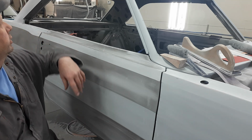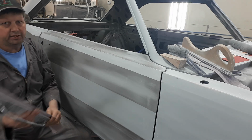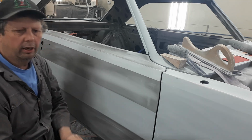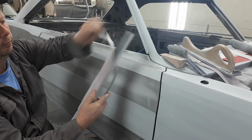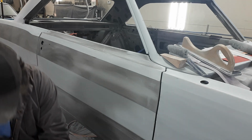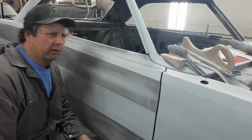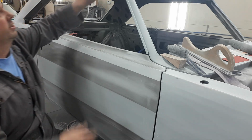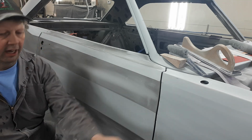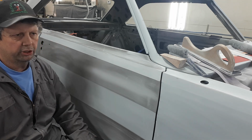Anyways, what we do here is we start off with numerous apparatuses. One of these is a big hunk of aluminum that I had milled flat. It's got Velcro stuck on it, with sheets of paper on there. Sand her down. That's for ultimate flatness. If you've got a bit of a curve, as I said before, these fenders curve a little bit, the roof, whatever, I use one of these for that kind of thing. It's a Durablock. See what I'm saying? Again, with the Velcro. So I'll use that in the 120 stage.